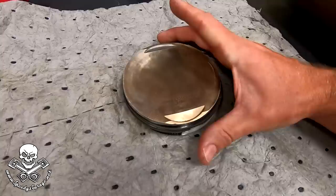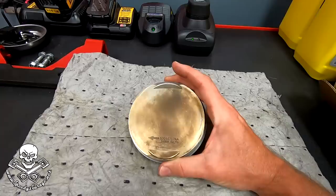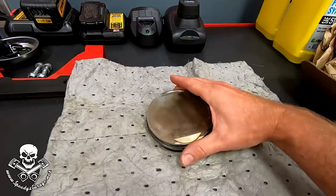I'm going to show you a close-up of the piston in question — this was cylinder seven. You can see the top looks pretty normal. It would sit in the engine just like this, and you'll notice the arrow is pointing towards the front of the motor. If there had been detonation, problems with boost, fuel, timing, tune — anything like that — you would see some little spots that look like they had been welded on the top of the piston. When we actually opened up the engine, this was sitting at the very top of the cylinder — we pulled the head off.